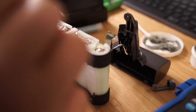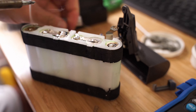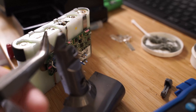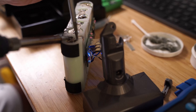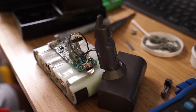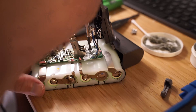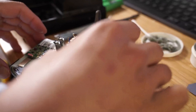If all voltages look normal, solder on the main positive and negative battery terminals from the circuit board to the first and last battery cell, then measure the top two prongs on the top of the battery pack where the battery attaches to the vacuum and make sure it reads around 21.6 volts. If all goes well, you can start reassembling the battery pack, which is the reverse of how it's taken apart. Of course I misplaced the spring so I didn't film putting the battery pack fully back together, but you get the idea.